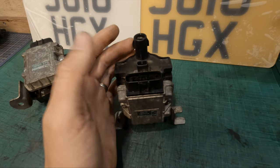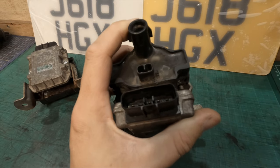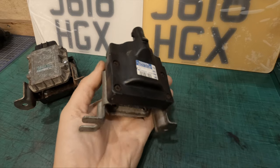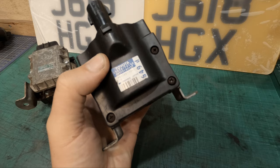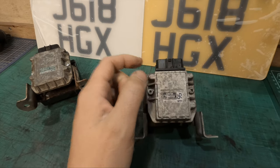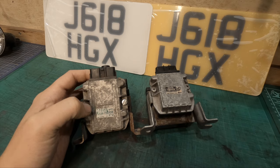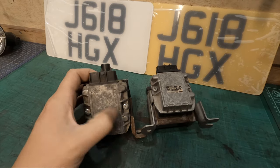I'm getting an engine light on the dash, and I'm hoping this is the problem. When I did the diagnostics, I got an error code of 14, which apparently is this guy here. So I'm hoping it has something to do with the igniter. Now, I'm assuming, this is an NA igniter. I would imagine that the turbo needs a turbo igniter, because I imagine that they run differently.